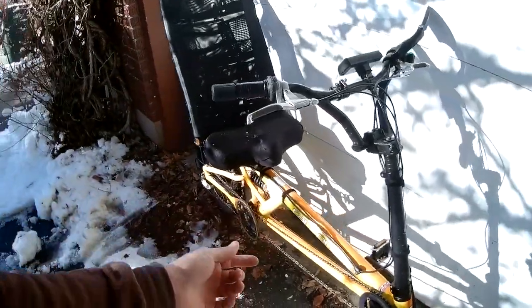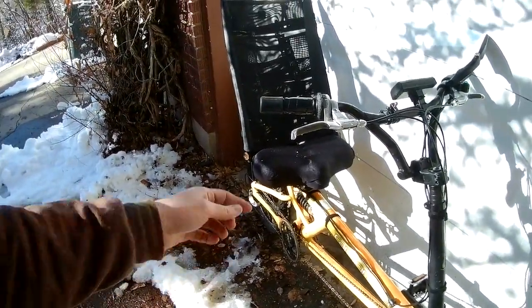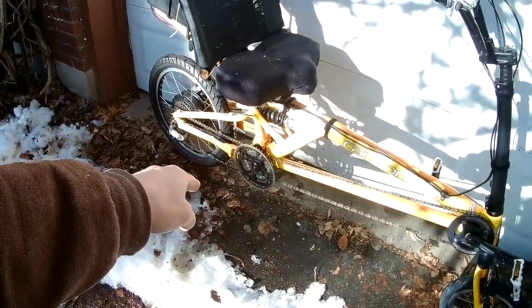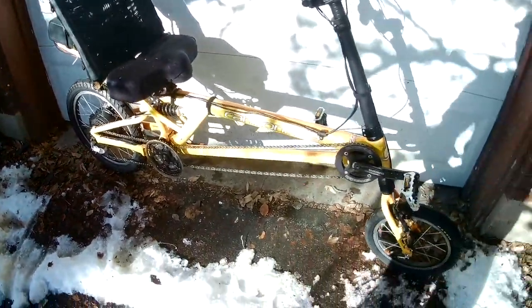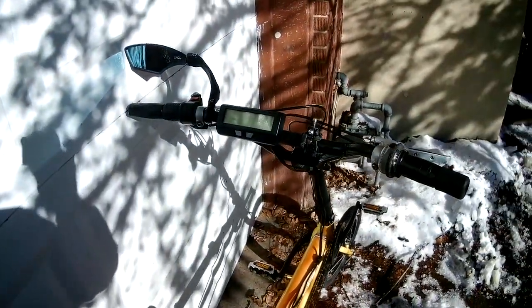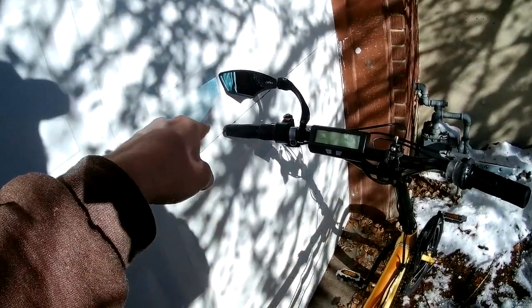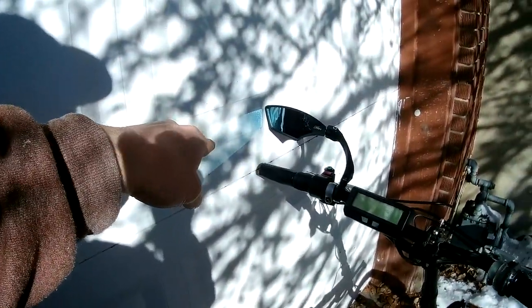I've got your standard-issue BMX handlebar that I like to put on pretty much everything. This is the crappy shifter that came with the bike — I guess it was stock and then got beat up over the years. I eliminated the rear shifter because eventually I'm going to get a gear ratio that matches the top speed of the future motor and I'll have no need for it; the gears will fully cover the range of speeds I'll be traveling at. And other than that, it's got a cycle analyst I've had for the last five years, a little damage and whatnot, and a cheap mirror so that instead of tilting my head backwards to see what's behind me, I can see it instantly. And you can tell that's a pretty strong unit because it's being used to hold the bike up — $15 Amazon mirror.